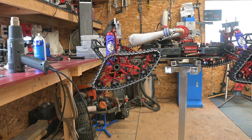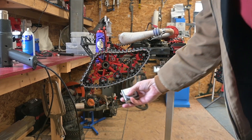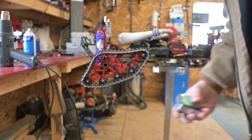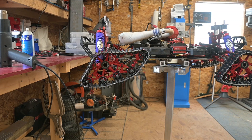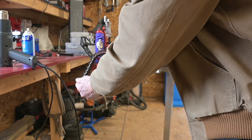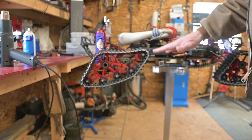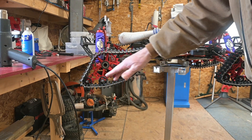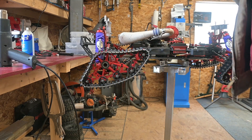I'm hoping to correct the rears first and take care of getting that angle corrected. This one is sitting probably around upper teens — around 20 degrees or so. They do not rock back and forth other than some play; they do not give. So if you're going over sticks or through rough terrain, you're not going to get them to oscillate. I want to get these bogeys sitting flat or slightly tilted up a little bit.